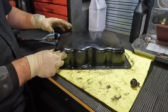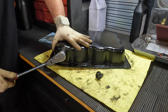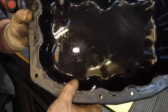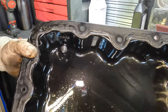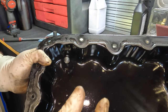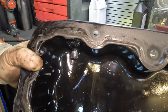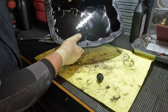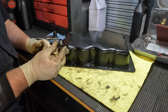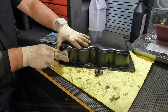Alright, I got it tightened up and it's a really nice snug fit. To demonstrate, you can actually lift up the whole oil pan by the plug — that's how tight it is. If I flip the pan over you can see what happened inside: it cut its own threads, and the front nose of the plug kind of collapsed and conformed to the hole. The plug is now nice and tight, compared to the original which would just spin around and never tighten.